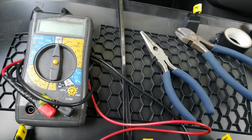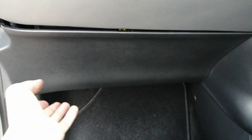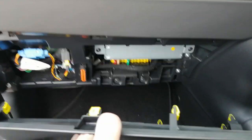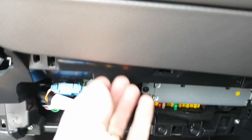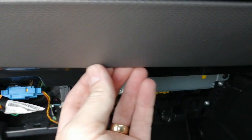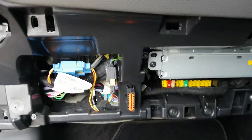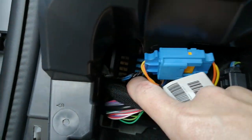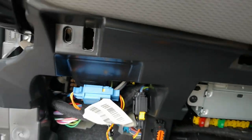First things first, we need to remove a panel. On this right-hand drive car, the fuse box is on the passenger side behind this panel. It pops off on little clips. I recommend pulling the bottom piece off first, followed by the top — if you pull it awkwardly you can crease the soft trim, so just take care. The fuse box is located there, which is quite buried, and that's why I have the long nose pliers to pull fuses out.